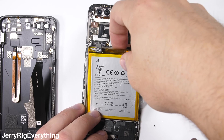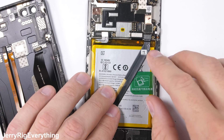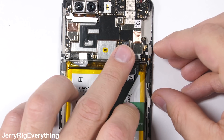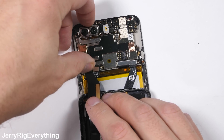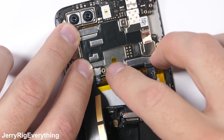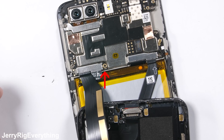I'll tuck the boring yellow battery back into the frame, then plug in the extension ribbon cable over the top and protect it with that metal bracket and bottom right screw on the motherboard. The charging port is next — I'll clip that right by the battery, which plugs in last. The whole thing is held down by the last metal latch and the final screw.